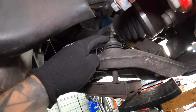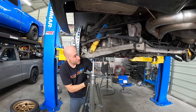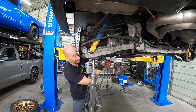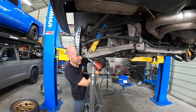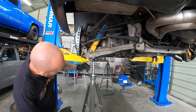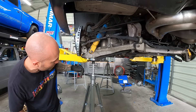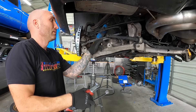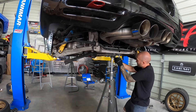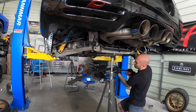The c-clip is removed. Put the 21mm wrench there, support with the safety stand, and hit it with the 18mm gun. There it is. Pull this bushing off the top and the bolt should be mostly free. Lower the safety stand to relieve the mono leaf spring pressure. With both nuts removed, take off the sway bar end link and that side is free.